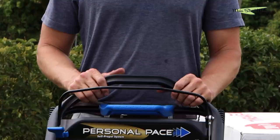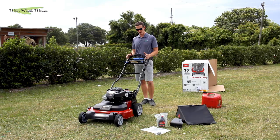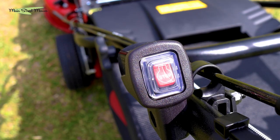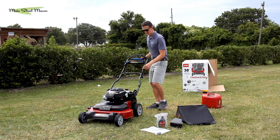Normally this feature is what turns your mower off — letting go of this puts a brake on your engine and stops your mower. On this one you don't have a brake, so you have a kill switch right here. You hold that down and turn the mower off, and when you let go it bounces back to on.